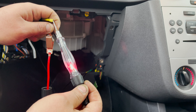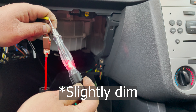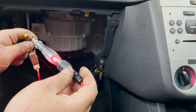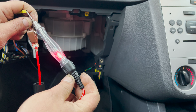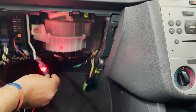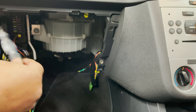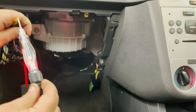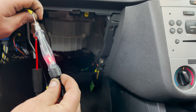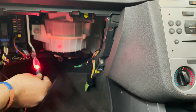For me here I can see this light is very dim compared to connecting to a proper power and ground. Now I'm going to use a ground in the car and it should be a lot brighter. I don't think it's going to show that well on camera, but I can tell here - looking at the test light it's quite dim rather than when connecting to the car directly, where it's a lot brighter.